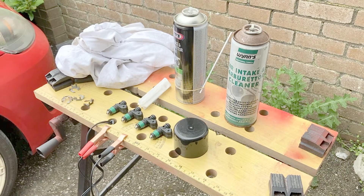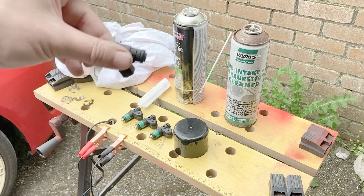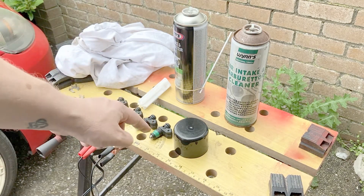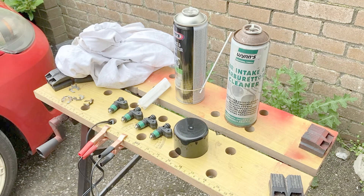Considering this is probably the dodgiest bit of kit I've ever used, I think it's done the job. There was this one injector that wasn't atomizing, and it is now atomizing the carb cleaner properly, so I'm pretty confident it'll do the same with petrol. All four are now producing the same misty spray, so I'm confident I can put these back in the car. While I reassemble, I'll use the same stuff to clean the throttle body. If I have any other issues after that, I'll be looking at the ignition. For the sake of £10 you've got to be prepared to make a mess and MacGyver it a bit, but I'd say give it a try.